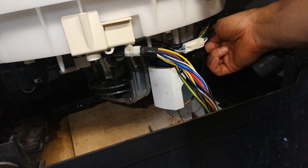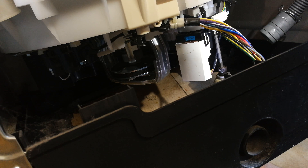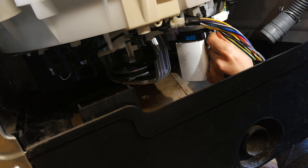Something has gotten in here and is blocking one of these little blades, so it's actually not spinning. I've got to open this fitting here to find out what is stopping this little motor from spinning — and that's why the water is not actually exiting this drum. I'm now going to open this motor here and have a look.